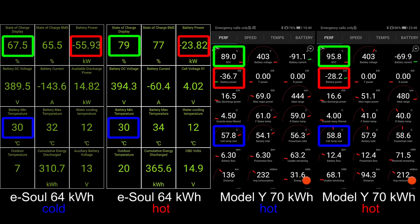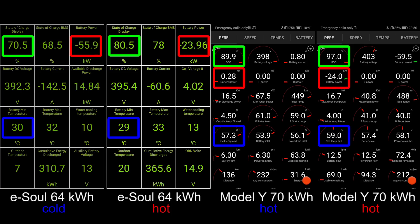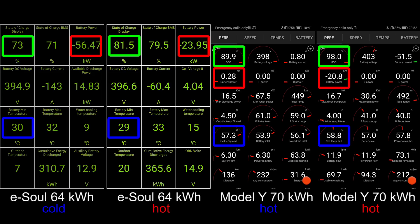This indicates that it's running the cooling to prevent it from heating up too much, and it just stays around there. The speed is very stable, at least on the hot session. We will hit another break point soon at 73% — there, now it drops even more. So like I said, the Korean cars, they have pre-programmed this to have certain break points on the state of charge and also on the battery.